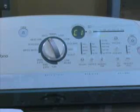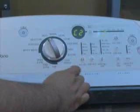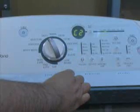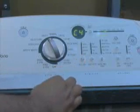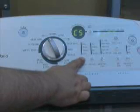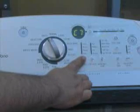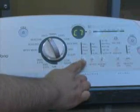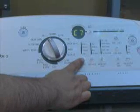Automatic Diagnostics will walk through 9 steps testing different components. If you press the same button used previously, it will advance through the automatic steps, checking the slow spin speed, the warm water fill through the fresh and detergent valves, the cold water fill through the bleach valve, the hot water fill through the fabric softener valve, the warm water fill through the detergent valve, the agitate if there is water in the machine, recirculation, the drain to the basket engaged, drain and slow spin, and then finally coast to a stop. When it gets back to C0, it's the end of the diagnostics.